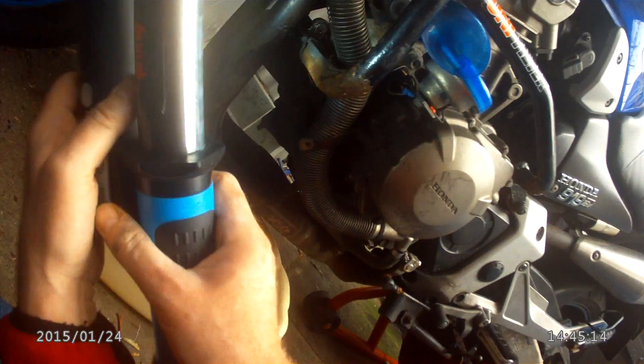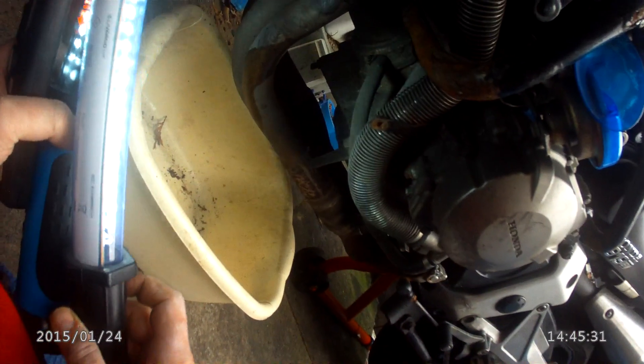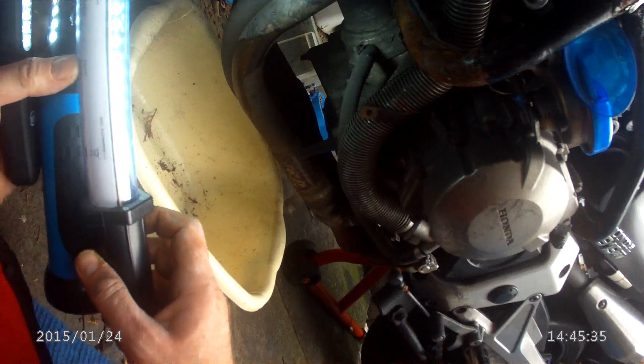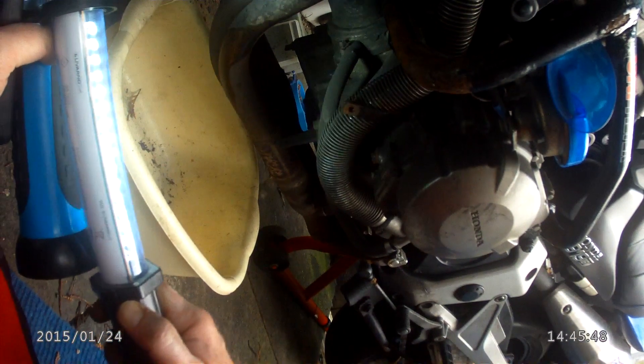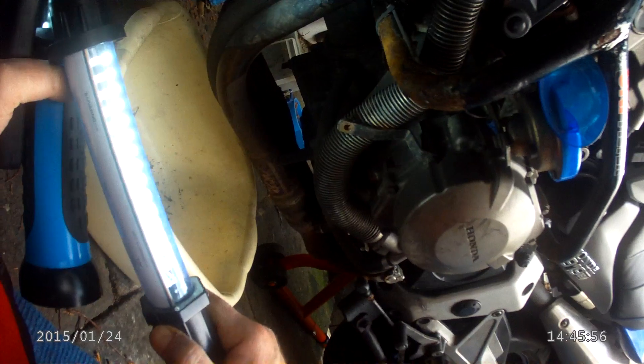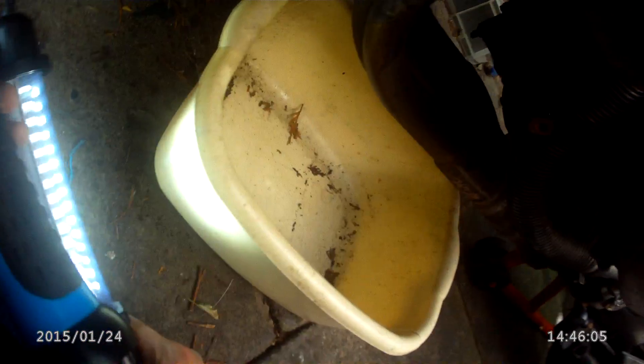Let's get some lights on here. Can you see that? It's just full of rust - the sort of rust that's eaten right through. Just awful, no way of cleaning that up. There's a water jacket going on, a flexible pipe near the filter - the water jacket goes in and out there, must be near the water pump. I'll spray some WD-40 on. I was going to take them off today and repaint them, but they're just too far gone. So I'm going to send for those 30 quid ones off eBay - saw them off, scrap these, throw them away and fit the new ones.